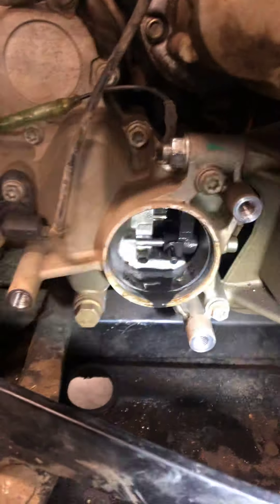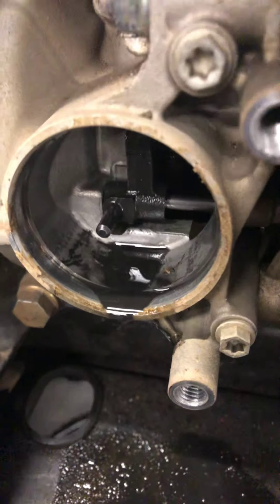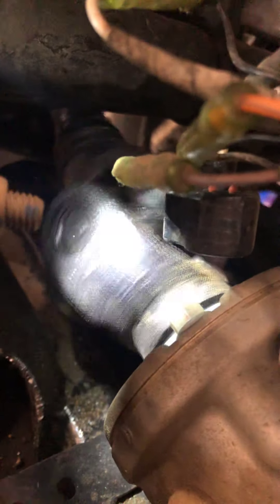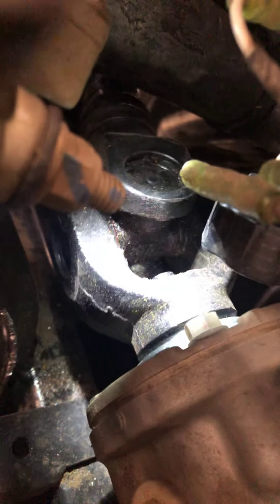Something's in there bouncing around. That would be four wheel drive — click it over to two wheel drive and it's still making a noise. You can still see that this little shaft here is bouncing around. Something got wedged in there — it's hard to show on video but there's a piece that's bulged out. Something internal grenaded in there.